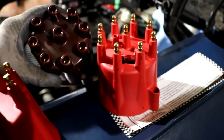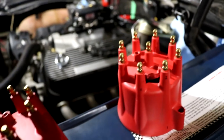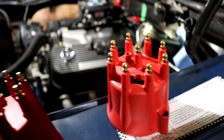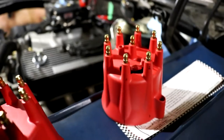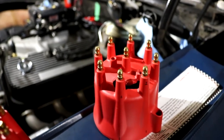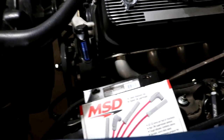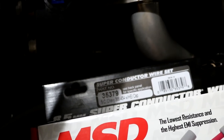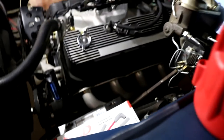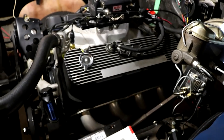The cap that came off my previous distributor was socket style, but the new distributor is HEI style, so I had to get new spark plug wires. I made the mistake of not searching my own part number — I went to the parts store and asked for ones for a big block Chevy. They gave me the wrong ones. I installed them and they were wrong, and I can't return them because they were used. The correct part number, at least for what I believe is a 1966-to-1973 big block Chevy, is 35379. So that's $160 down the toilet.